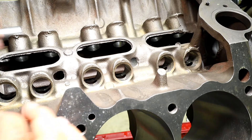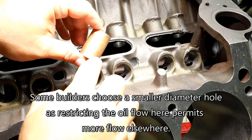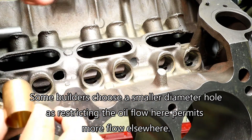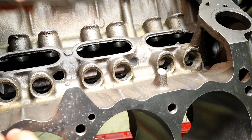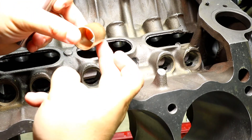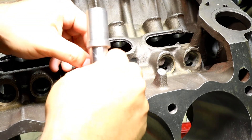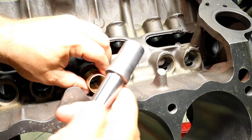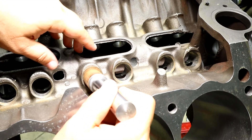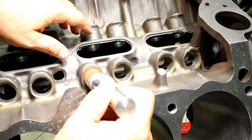So how are we going to make this happen? We're going to drill an eighth-inch hole one half inch up. With that hole, we're going to make sure that it is lined up on the bottom with that port, and then we're going to drive it in using this tool. We're going to drill that eighth-inch hole about a half inch from the back, line it up, make the mark, set it in place, and then go ahead and tap and drive it into place.